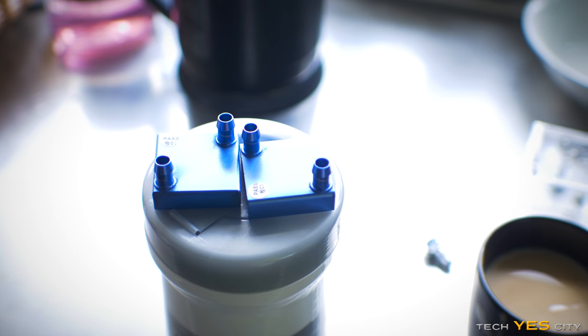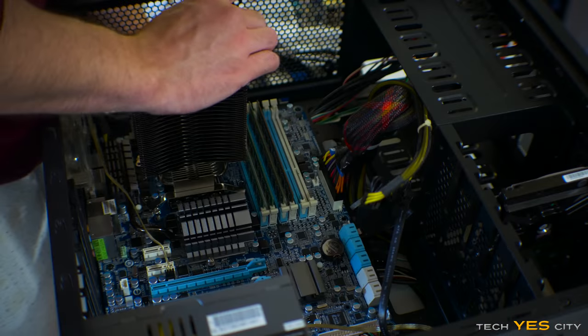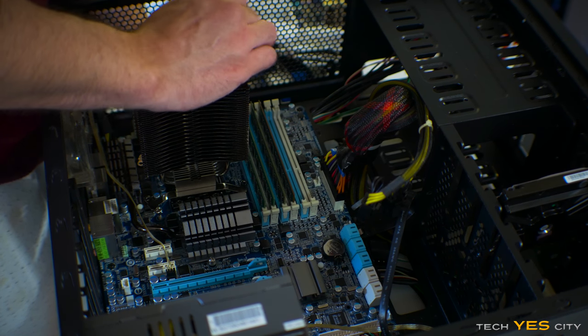And when you compare that to an air cooling setup, I would rather take the air cooling setup any day of the week, even in price performance, compared to this loop. Not to mention all-in-ones will absolutely kick the pants off today's loop. If you got two 120 mil rad setups and put them on your CPU and your GPU, you would still have much better temperatures and results than I got here today.